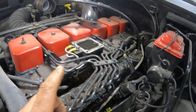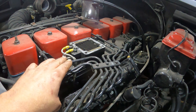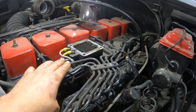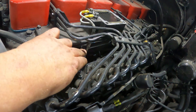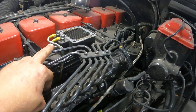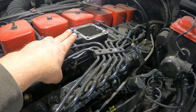There's the grid heater right there, and I use the old wiring off a Ford 7.3 for the glow plug solenoids — glow plugs and glow plug solenoid. That's what I use for this here. So that comes in as one wire, as you can tell, and then splits off for your glow plugs, but now I'm using that to heat up the grid.